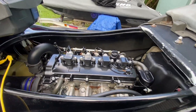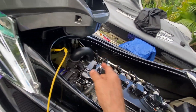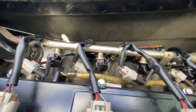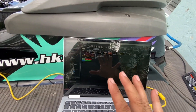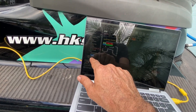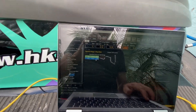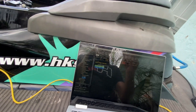First thing we're going to do is power up the Haltech, which we've got hooked up to the laptop, and prime the fuel system so we can check for leaks. We've got pressure — no leaks, looks dry, that's good. Now over here in the Haltech, we go right to our Stage 1 fuel injector flow rate and we're just going to change it to 1000cc. Then we're going to change the dead time as per the recommendations of Fuel Injector Clinic as a good starting point.